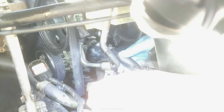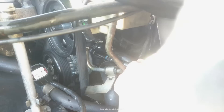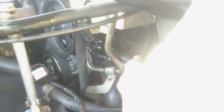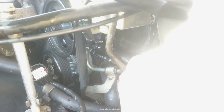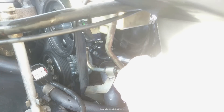Then the stat housing can just go back in. I did the bolts up finger tight, and then went around twice with a torque wrench at 10Nm, which is the specification. I must admit, last time I did these up with the ratchet handle just by feel, and I probably over-tightened them. It's possible that may have contributed to the gasket failing, although I think the stat body sits flush against the engine block anyway, so I don't think so — but it's possible. Anyway, it's always better to use the correct torque.